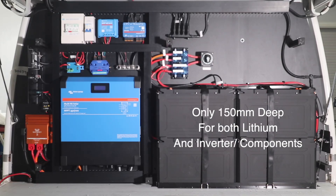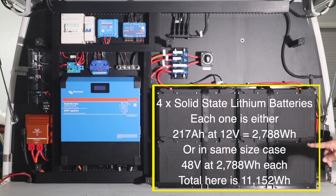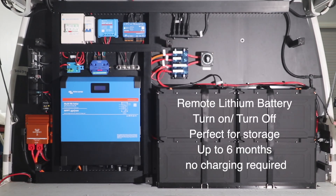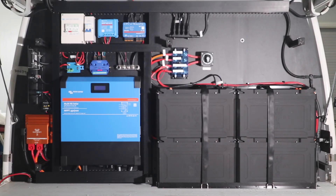We've got four solid-state lithium batteries down here. In 12-volt speak, that's the equivalent of 850 amp hours at 12 volts. You can see how they're stacked on top of each other — it could be possible to add two more batteries, giving a massive amount of power. There's a remote start/stop which we're going to set up on the side, so even though we can't get to the top of the batteries, we can turn them on and off for storage. And we've got the isolator up there.